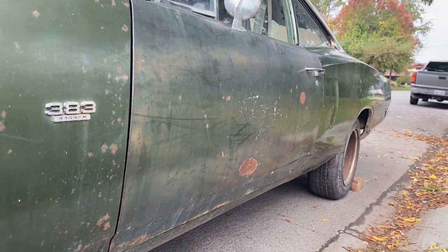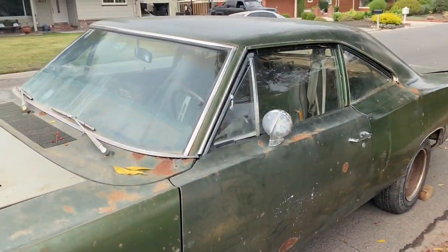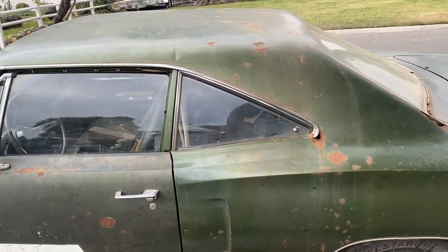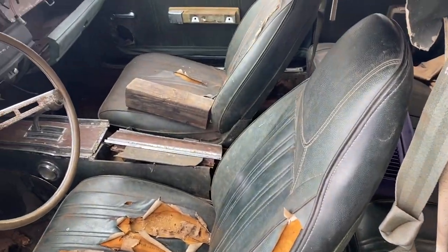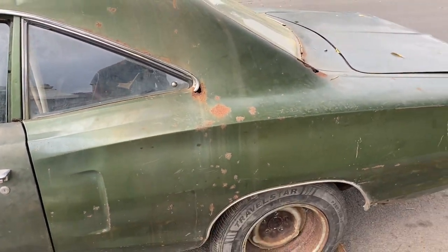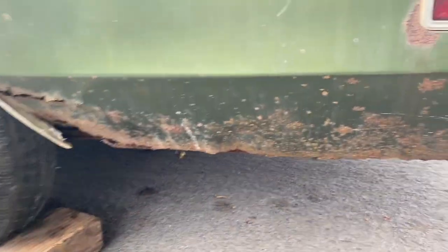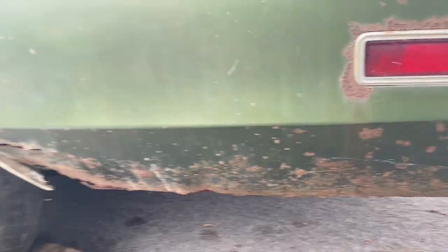The door looks good. Rockers look good. It's got all the glass — that was a big plus. It's a two-door post, so it's got the pop-out windows. What I really like is the order with center console and bucket seats. This quarter panel is the better of the two. You can see it's actually pretty straight. Lines are good. This lower quarter needs to be replaced, but we could cut it right along that body line and put a new lower — not going to need a whole skin, which is good.